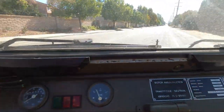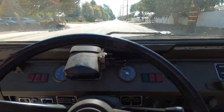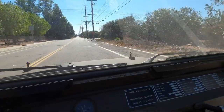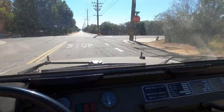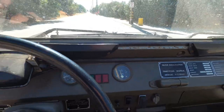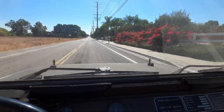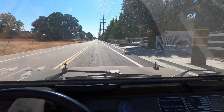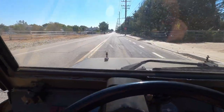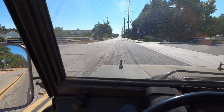All right, so here we are on the road. I'm at just over 3,000 RPM at about three-quarter throttle and the speed is just gradually going up — we're on a tiny bit of a downhill here which helps a little bit. Now I wasn't planning ahead so I'm hitting the brakes pretty hard to stop. When you do that you can feel the belts dragging on the transmission — it's kind of fighting against you stopping. The best way to stop is to plan ahead: let up off the gas, let it start to slow down, then just tap the brake. That hill descent control thing kicks on and it'll slow down quicker for me with less drag on the belts.